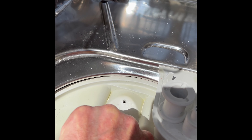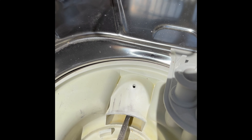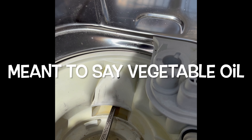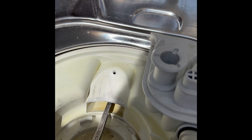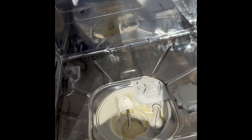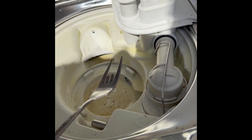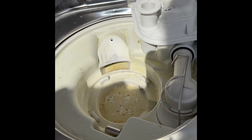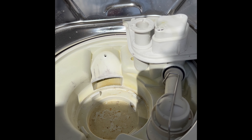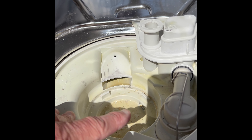Then when you try your cycle, let it fill, and when it's about to circulate you can add some mineral oil. The mineral oil will act as a lubricant for that shaft. Get that fork back out of there — isn't that easy? Then again, you put the mineral oil in after it fills and that'll lubricate that shaft a little bit and you'll be fine. Make sure this doesn't get dried out — usually takes about three weeks for that to evaporate, such as when you're away on vacation.